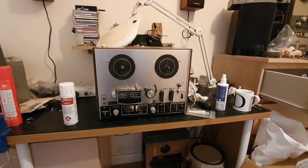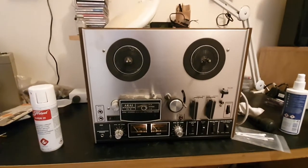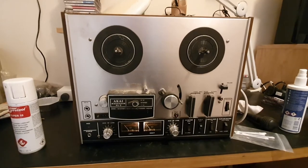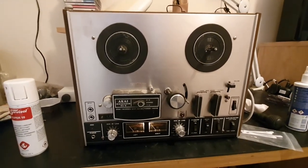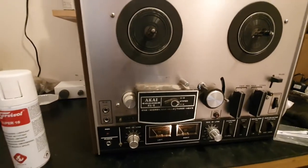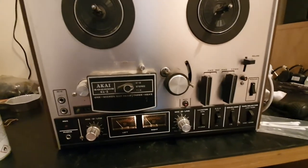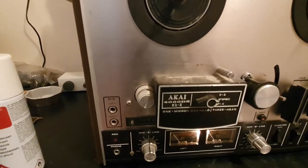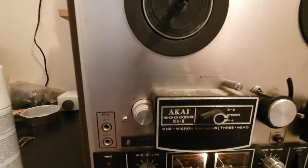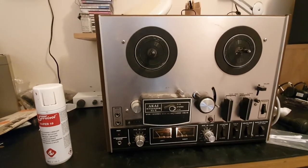These 4000 series machines are pretty good and very popular. The reason I buy quite a lot of them is that they fit into a Sainsbury's banana box — put some bubble wrap around them and they travel pretty well. They're very robust, relatively easy to service, and very reliable compared to the Sony counterparts. This is probably the more basic machine; the 4000 DB is above this with Dolby, but I don't really think you need Dolby on tapes because at 7.5 IPS there's virtually very little hiss.